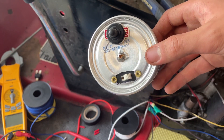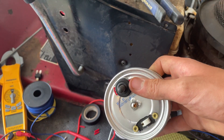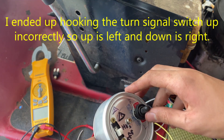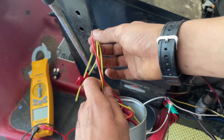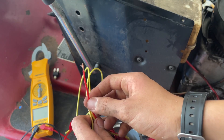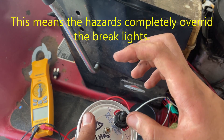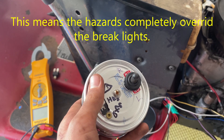This is the turn signal box. This is the hazard, and this is the turn signal. This is the back — I haven't wired it yet. This is the inside of the hazard and turn signal box. When you put this in right turn or left turn, it will supply power to either the right or the left turn relays, and the power comes from here. When you use the hazard, it's like the turn signal but it powers both the left and the right side relays, so both sides blink like a hazard light.